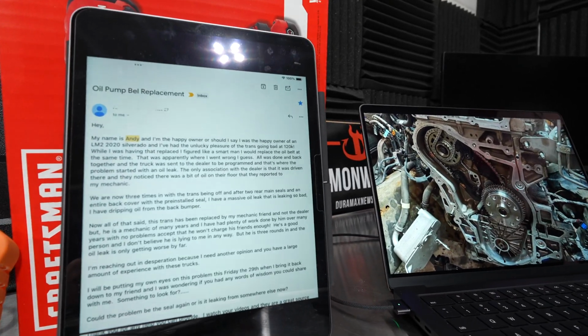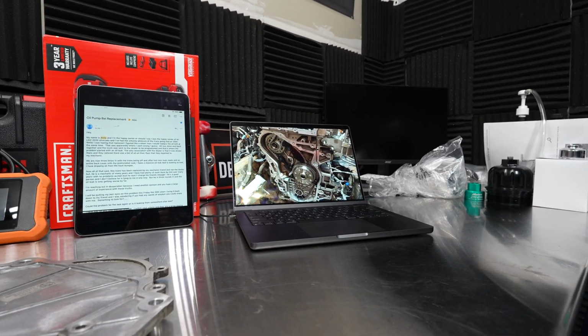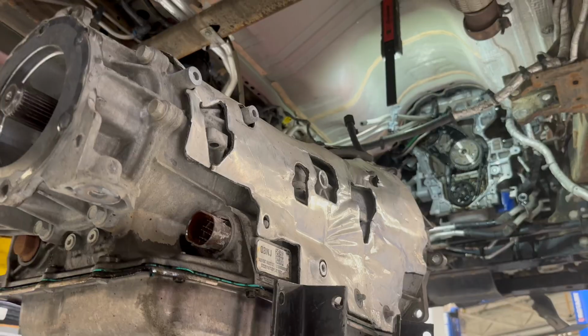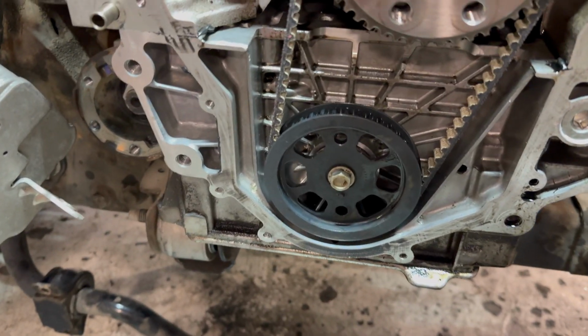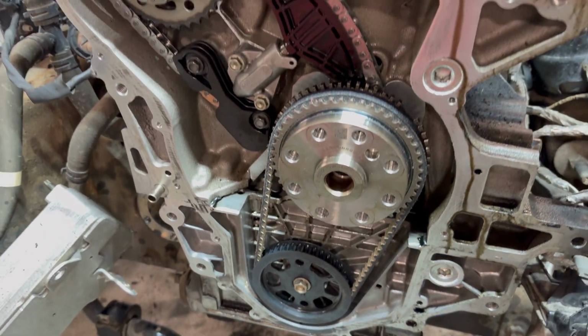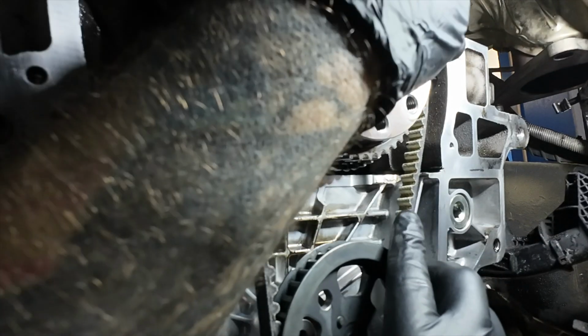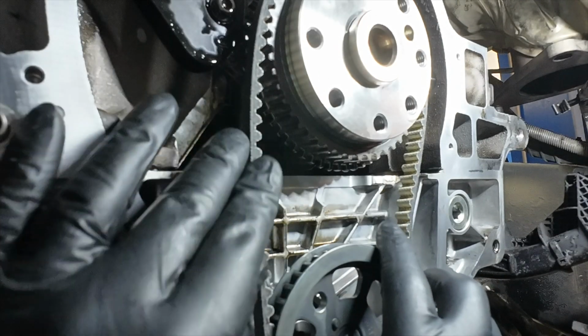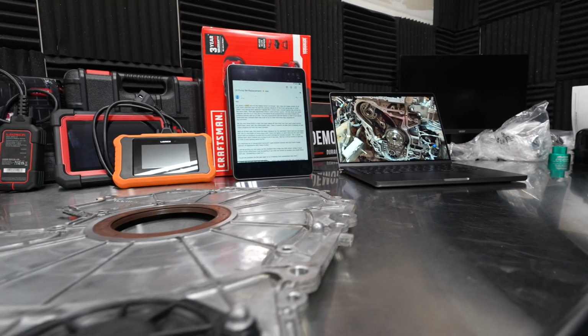So Andy says that he had a transmission failure at 120,000 miles. So when going in there to do that, he went ahead and did the oil pump belt, which is definitely recommended because it's due at 150,000 miles or 200,000 miles, depending on your year of vehicle. Now in 23, they upped it from 150 to 200,000 miles. So I do have a video on the total cost of that if anybody's wondering. Link will be in the description of this video. However, let's stick to our oil leaks.